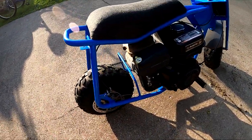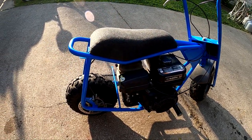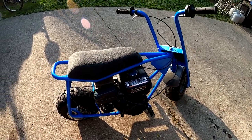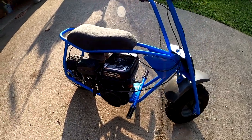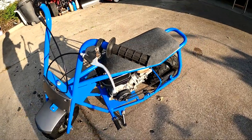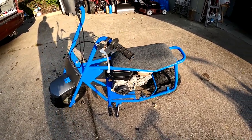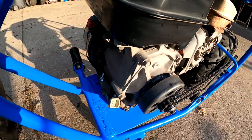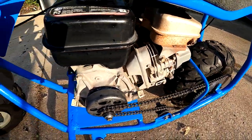the rear brake, everything that was lightly rusty got cleaned, ultrasonic cleaned, sanded, wire brushed. We degreased the motor with some motor degreaser from O'Reilly's two times and shot it off with the garden hose, and all in all I'd say it looks pretty good. There's nothing slippery, nothing greasy, it's all pretty clean.